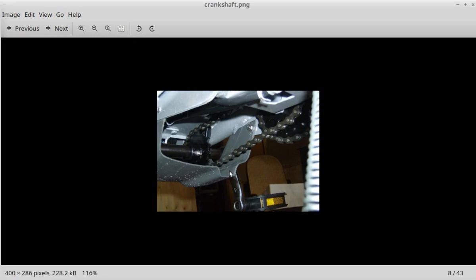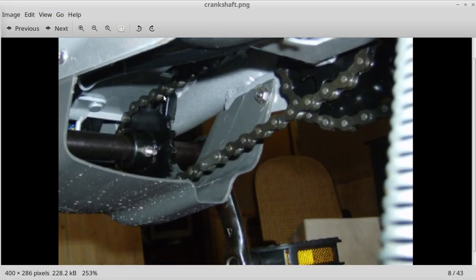And again, here is that picture where we're talking about that. So right here, this is your block assembly that attaches the axle to the bike, and there's a bolt here, and there's a bolt up here, and there's another set over here. So this entire assembly, if this pedal hits a sidewalk, is designed to tear at this point and behind the sprocket at this point and come loose. That way the bike and the rider don't get thrown onto the road. Instead, the blocks tear away and the axle will be bent perpendicular to an angle to the bike.